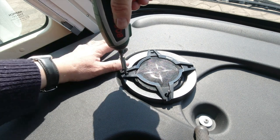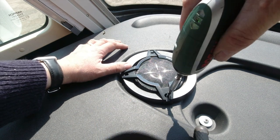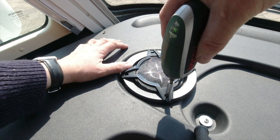There we go. That is how you cut a speaker hole in a non-even surface using a jigsaw. You can obviously use other tools — you could use a hand-held pad saw, a Stanley knife or a craft knife — but be very careful if using knives, particularly when you go around corners. You always end up pulling towards yourself and cutting a finger off, so in many ways the power tool is actually safer.